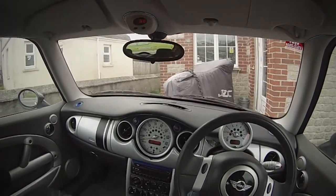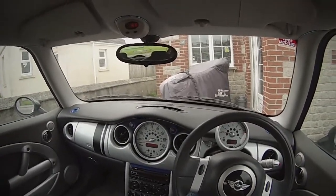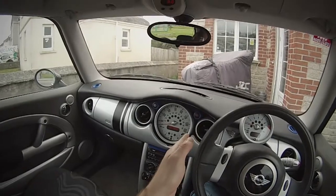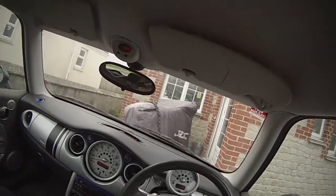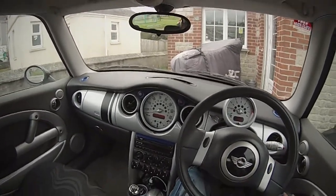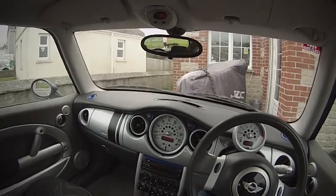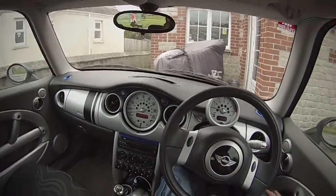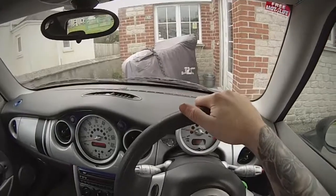clean. The thing is, with the mass airflow sensor, it obviously senses airflow going into the engine, which increases when I put the foot on the pedal, which then in turn opens that butterfly that I talked about, which then obviously increases fuel consumption naturally, because you need more fuel to accelerate. Yes. If you don't clean the butterfly and the mass airflow sensor, especially at 85,500, maybe nearly 86 actually there, it looked as though it's never been cleaned. Let's be honest. I don't know if you've seen that oil that was on the butterfly, or an oily substance. It's minging. So either way, I've done it a favour.